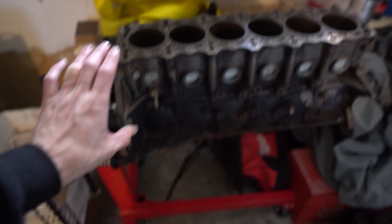That motor was toasted, so good thing Zach had another motor ready for me. I tore this one apart at Zach's but didn't record it because I was rushing to get it to the machine shop. Here is the new motor — this is freshly hot tanked. Next I'm going to scotch bright the sides and do a nice coat of silver paint on it, like my last motor. While at the machine shop I got it blueprinted and have all the measurements. I ordered standard size bearings, piston rings — everything to get this thing ready to go. I didn't overnight it, but they are two-day shipped, so in the next day or two I'm going to be knocking this out — getting the bottom end together, the head gasket on, slapping the head on this thing. I have the crank wrapped up on my shelf right now, and you guys will see it in the next video when I put it in the motor.